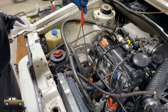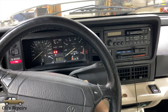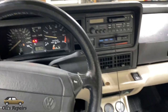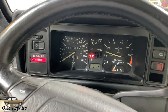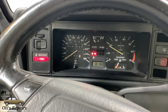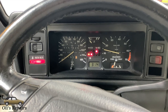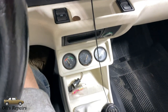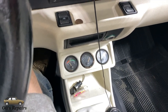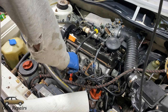Now we are going to fill up the engine with three liters or three quarts of engine oil. The spec is four liters for an engine oil and filter change, but we already put some in the oil pan and some in the filter. Check it — we want to make sure the level is at least above half. Here it is right at the half mark. And then moment of truth.